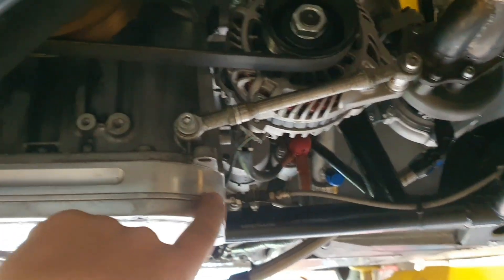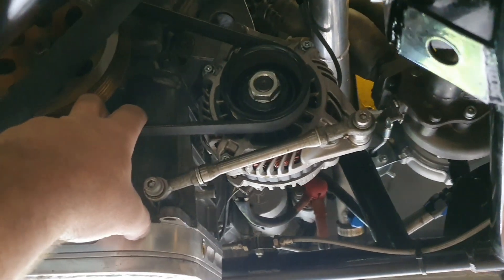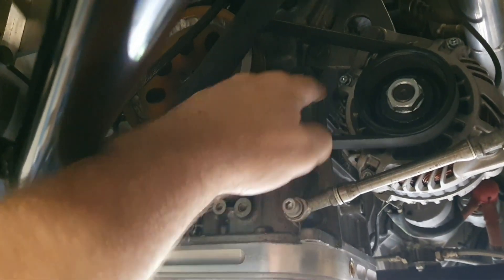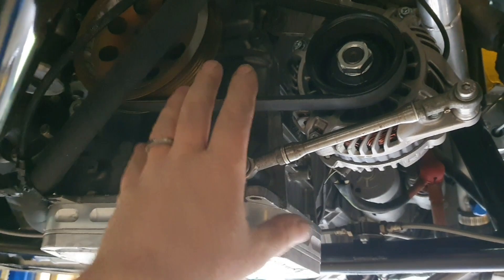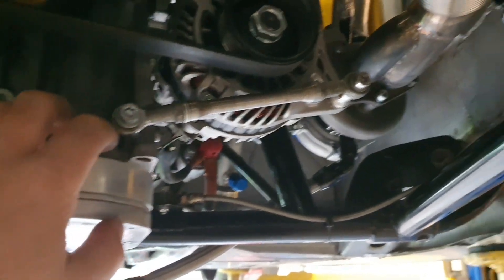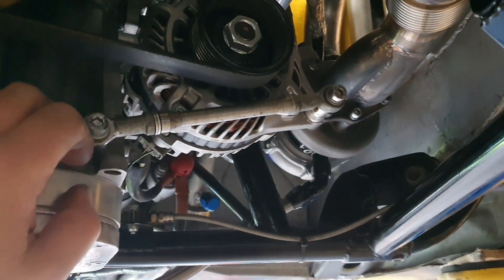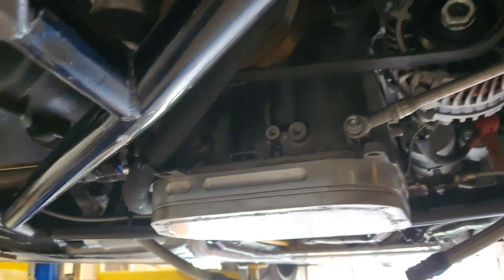The other problem is that these drains are below the oil level in the sump. If you have quite a lot of crankcase pressure — the rings are a little bit leaky, which we know we have some blow-by on this motor — it tries to force the oil out of the crankcase any way it can. It'll pressurize all that oil, give it whatever crankcase pressure there is — maybe one or two PSI — and try to push it out of that hose against the pressure inside the turbo core. It won't overcome the turbo pressure, but it will reduce the differential, which is not a good thing.